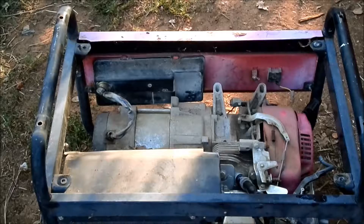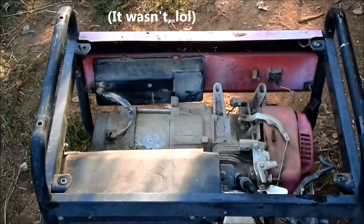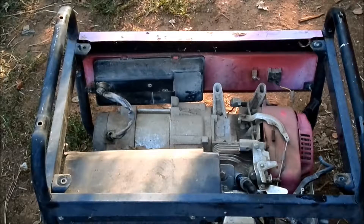I could not find my plug thread chaser, so I just carefully kept going back at it until I caught what feels like the correct thread, because it didn't fight me a whole lot going in. The plug's back in. Couldn't get it to start - thought maybe I didn't have enough pull on the rope since the recoil was half-sprung, so I've just fixed the recoil. Let's try it again.